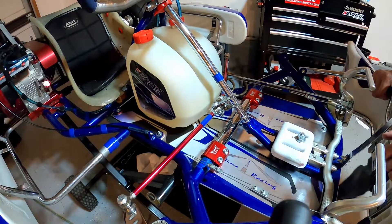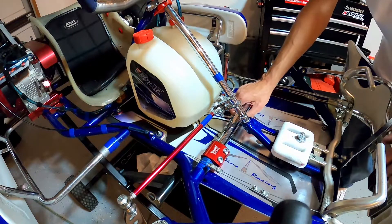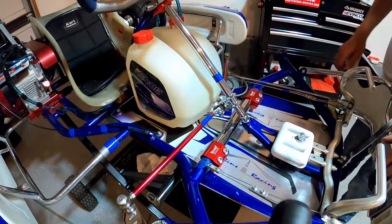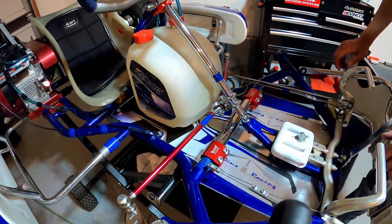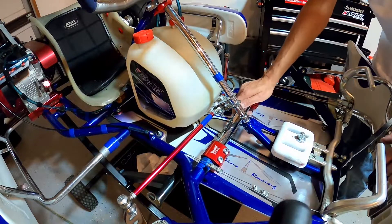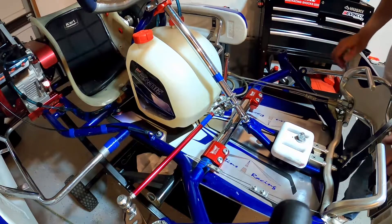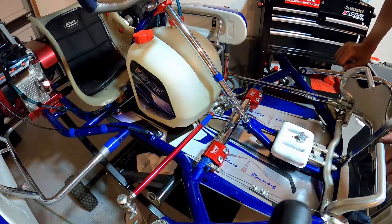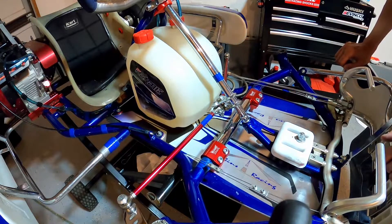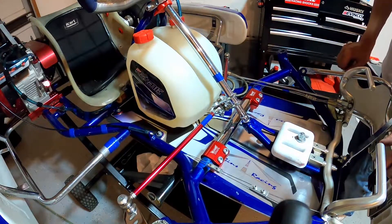You're definitely going to want to get yourself multiple front torsion bars so that you have the ability to make that change when you're at the track. This is my preferred front end go-kart change — if my driver comes in complaining that the cart's not turning through the turns the way they'd like, I'll throw in a stiffer bar. I find that changing the front end bar, instead of some of the other front end changes you can make, helps your tires last a little bit longer and doesn't make them wear as much. Tires are a big deal, so get yourself some front bars, go out and test them, and see what you get.